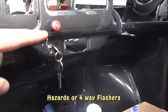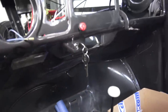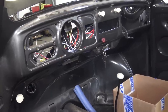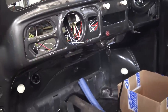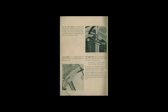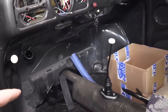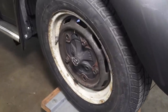'66 is also the first year they started using the flasher. If you get this set up correctly for your '66, that's pretty unique — from here onward all Beetles had a flasher. Going back to the high and low beam switch: with your steering wheel and turn switch hooked up, adjusting high and low beam was done with a snap at the back of the turn switch — click, click, click — as opposed to the foot press at the bottom.